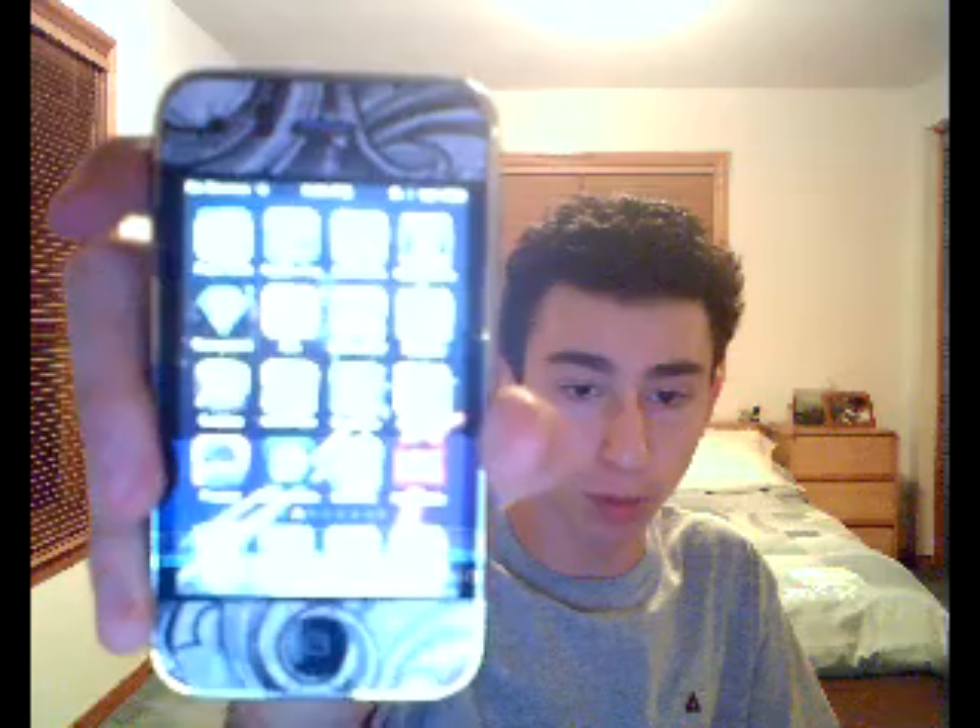Hey guys, this is a video tutorial on how to fix error 28 on an iPhone 3GS or boot ROM. This is my iPhone right here. I installed Spirit 2 Pwn for the new jailbreak for 4.1. After I installed Spirit 2 Pwn, I pressed the power button and got stuck in a DFU loop and could not restore through iTunes without error 28. This is a tutorial on how to fix this error — to prove to you that this is a jailbroken iPhone on 4.1 firmware.